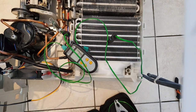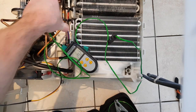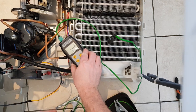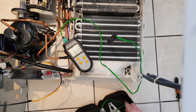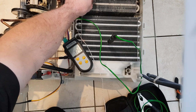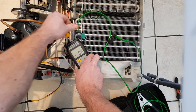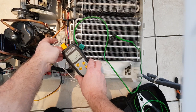These LGs have three major failures: one, the diverter valve has got fluff in it; two, the drain pump has got fluff in it; or three, the evaporator has got fluff in it. Pretty much fluff is the killer of these tumble dryers. The actual heat pump system - the scroll compressor and the gas system - is very robust and you'll very rarely see the heat pump actually fail. Most of the call-outs I get are the customer coming up to the end of their five-year warranty and they're just trying it on, or they haven't cleaned their filters.